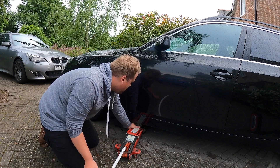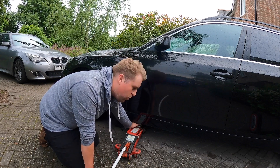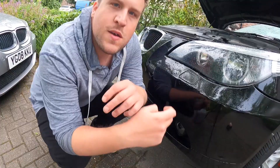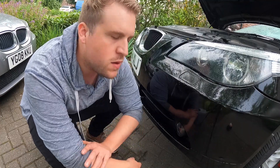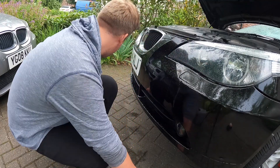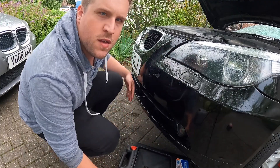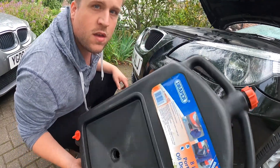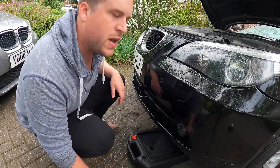This 5 Series has, for once, got its jacking pad — most of them fall off and get nicked, so that's good to see. First off, let's crack off the drain plug on the sump. If you've got a handy little catch can like this, that's always helpful. I'll go under and do that now.